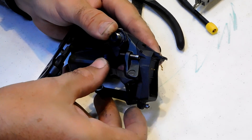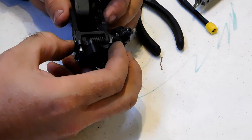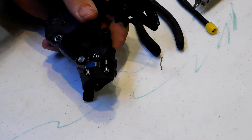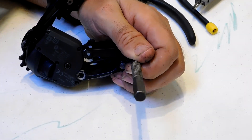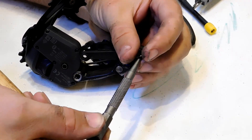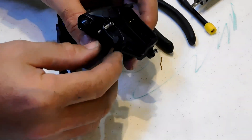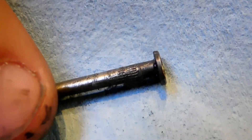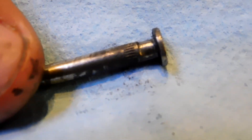There's that excessive play right there. Let's get this pin out. I have a rubber O-ring here. Now the pin itself — you can see there's quite a bit of wear right there at the top. So the pin is what the problem is on this derailleur.